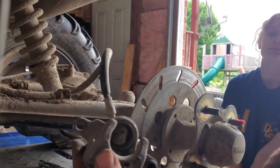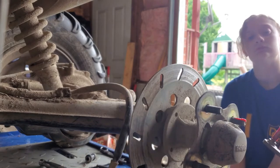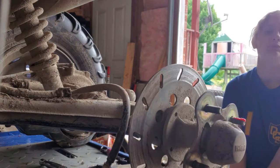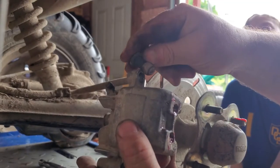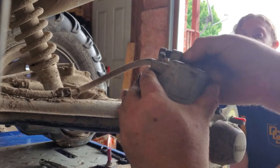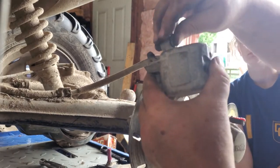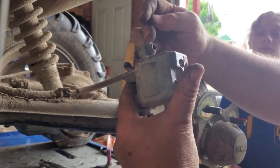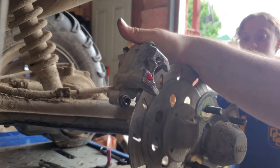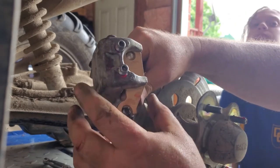Our piston's in place, we got our rubber boot back in, dust cap is on - same for the bracket. We cleaned up that pin, a little bit of grease on it, and it's got a rubber boot as well. We're going to put that back in - I took it out because when I heated up the caliper to get that one pin out, I didn't want to risk melting it. That just goes back in like that. If it's got any tears in it, you should consider replacing it because you can see the amount of dirt that gets in there - it'll fill up that cavity and your caliper will just seize up again in no time.